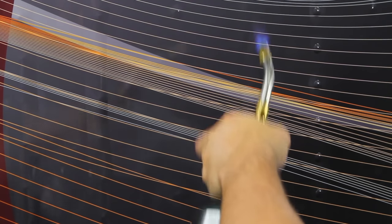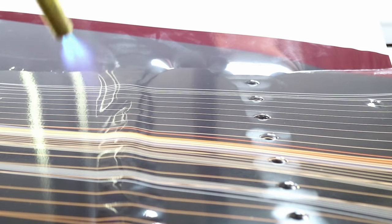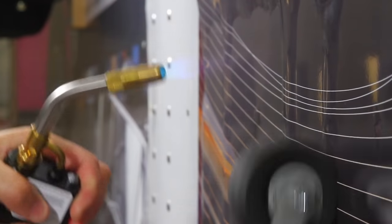If the application environment has a temperature outside the suggested range of 70 to 80 degrees Fahrenheit, try a few runs of rivets using different amounts of heat and roller speeds to get the perfect combination. This can literally change from day to day in some climates. Whether you purchase a proper application wheel or just use foam paint rollers bought at a hardware store, be sure the roller is firm and undamaged throughout the entire application. For some rollers, this may mean that you need to change it out several times during the application.